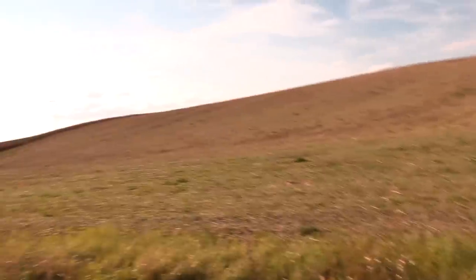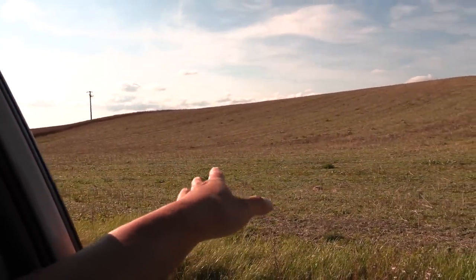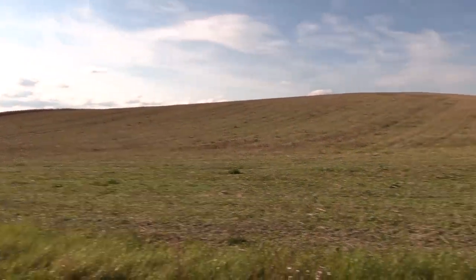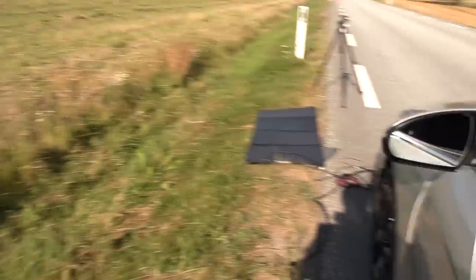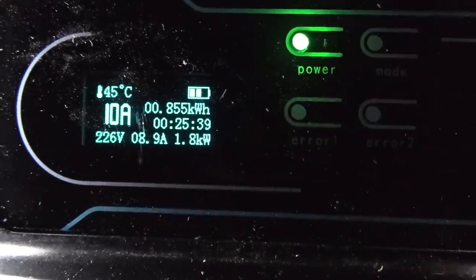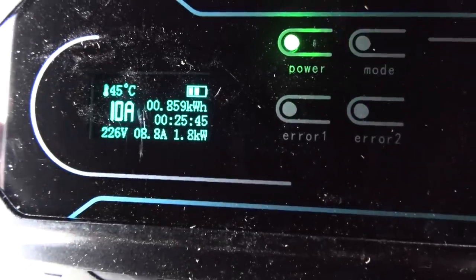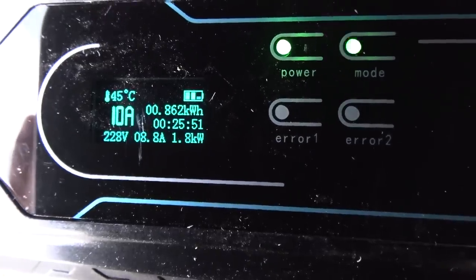I calculated that to get over to the charger, which is over there somewhere, I need 3 kilometers. And if I average, let's say with some uphills, 150 watt hour per kilometer, then I need 450 watt hour, which means that maybe just to be sure, with some losses, the cable needs to pass through, let's say, 1 kilowatt hour. And right now, the cable has received 850. Yeah, so after 25 minutes of charging. So we could actually just go soon. But I might stay here a little bit longer, just so I don't have to stop and set up again and then go for it.